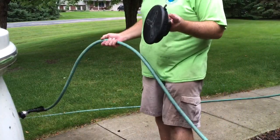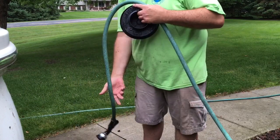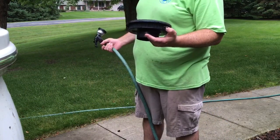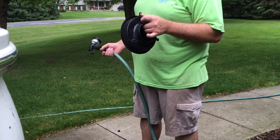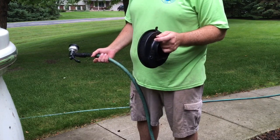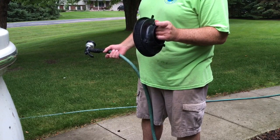Here is the flame arrester again — it's not bad. I'm going to start by cleaning it with a hose and put it in some soapy water and hose it off again. Some people say use carb cleaner — the advantage of that is it dries a little bit faster — but I'm just going to use water and soapy water and then a final rinse.